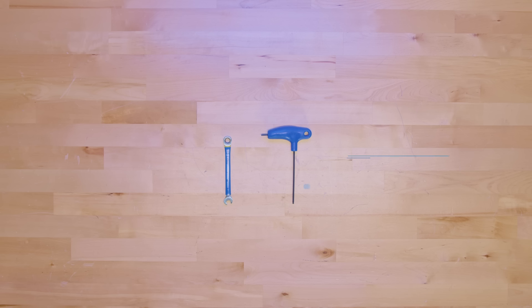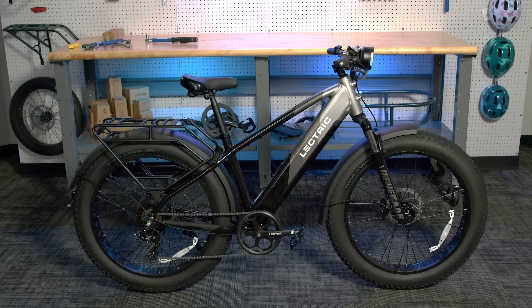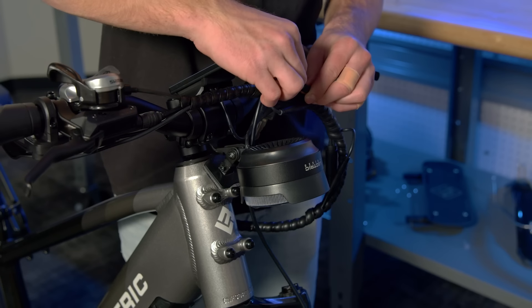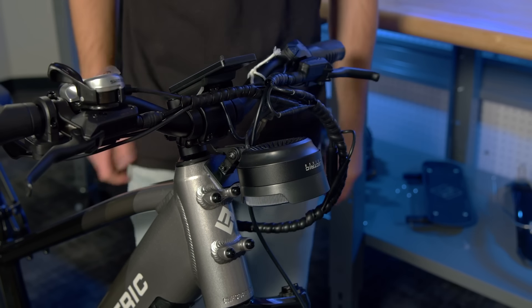For this section, you will need a 3mm Allen wrench and an 8mm wrench. Now that your Xpeak is out of the box, we can move on to setting up the electronics of the bike. You will notice that there is a quick plug at the front of the handlebars that is unplugged. This is the display quick plug. It is unplugged to prevent power drain during the shipping process. Go ahead and plug in the quick plug by pushing the male and female end in together. Make sure not to twist. You will know it is plugged in when you hear a click and you can no longer see the color on the inside.